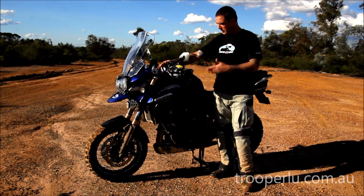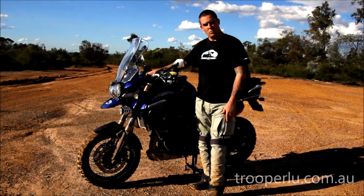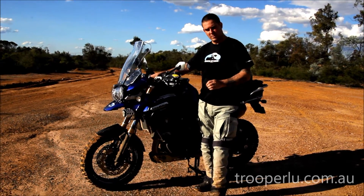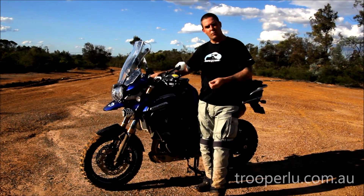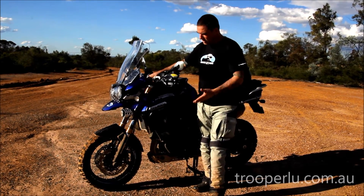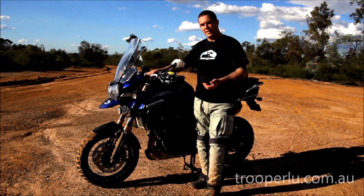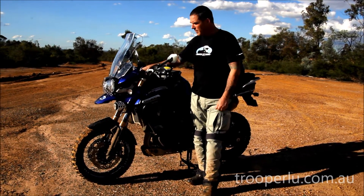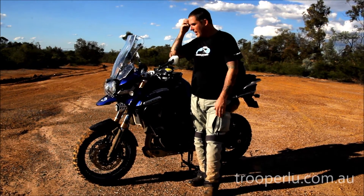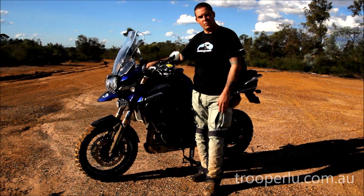It still can get away on you, but the suspension has made a big difference. What we've done on the forks is we've modified the internals of the forks and shortened the top out springs. This has given us an extra 40 millimetres of travel in the forks. We've gone to a 10 kilo spring in the front. We've modified the compression stack and the valving stack in the dampening.